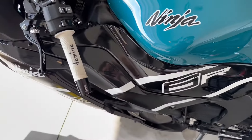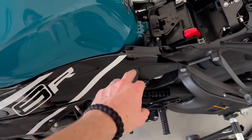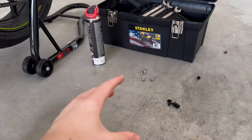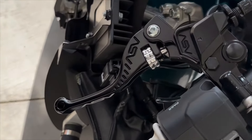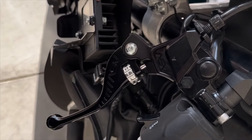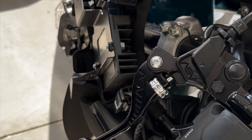So what you're going to want to do is take off this bolt and these bolts up here, and that will allow this one to come free. It's already free back here. Now that we got that side fairing off, we're just going to start taking off these bolts and putting them in a safe place so you don't lose anything. We finally got this off. There are a couple of cheeky bolts and screws up more towards the front connecting the side fairings to the front fairings. After you get these couple of screws off and you try to pull on them, you will feel where the tension is and be able to locate those screws and bolts relatively easily.